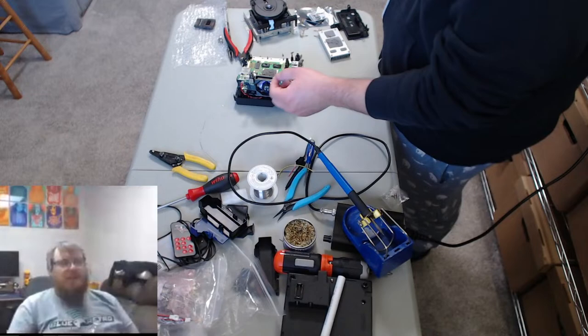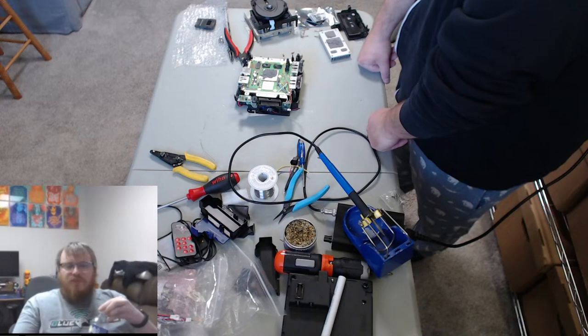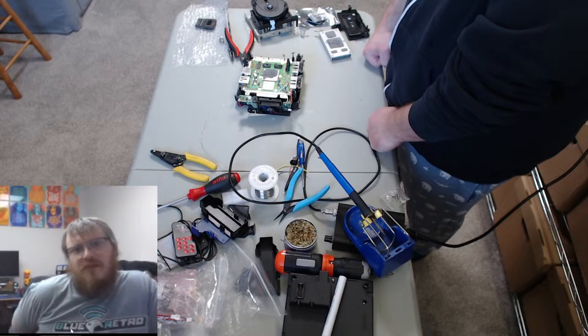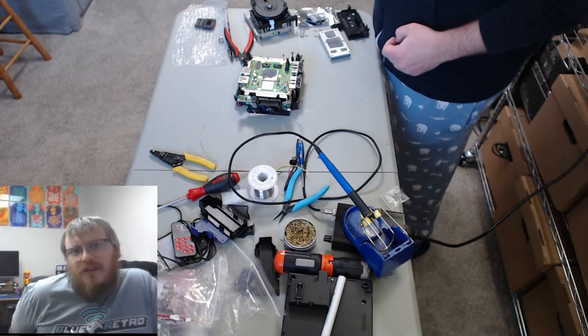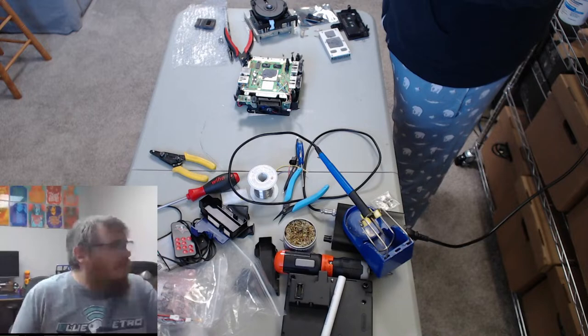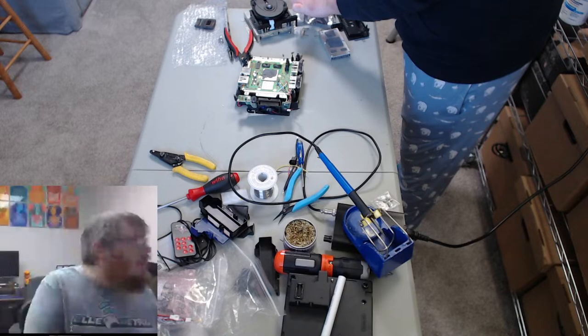Much better. All of these are less than 4 inches. Do you suggest I power it on just as is for 2 seconds to make sure it boots, or do I put the heatsink back on or anything else? Before you do that, if you want to check for boot, you need to get your SD2SP2 and put an SD card in with Swiss on it. Swiss should be named IPL.dol. So let me put the link to the latest Swiss. Yeah, you can go grab it.